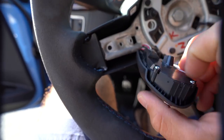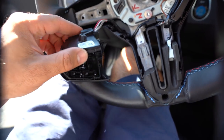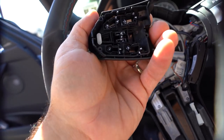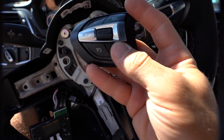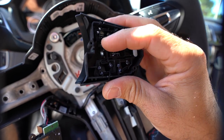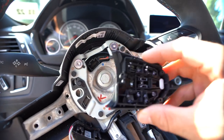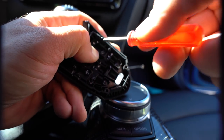After the switch panel comes out, you flip it upside down and that reveals three screws — get them undone. Once the screws come off, the whole front panel just falls out onto your knees. This is what it looks like on the flip side. You can do it in the car or on your bench; we'll do it in the car. These are the two buttons you're replacing — one and two. To remove them there are tiny tabs that you have to release. You see these little tabs — they click in place. Bend them out and the buttons will simply fall out.